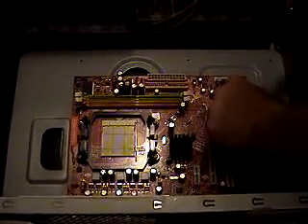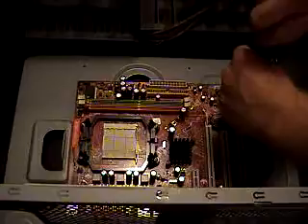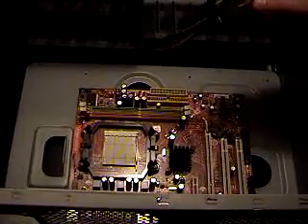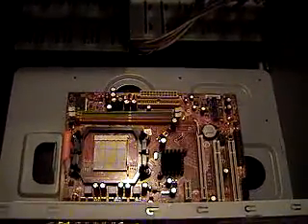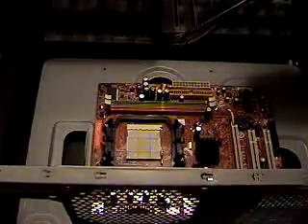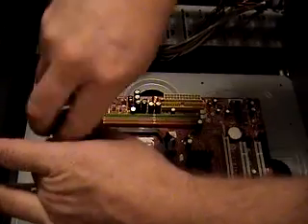You want to kind of slide it over a little bit and get it centered on the next hole, on the next stud, which is in the case. Make sure you have those studs real tight, because if you don't, it might stick on you in the event that you need to take it out in the future. This one's kind of off-centered — you have to balance it and tilt it forward a little bit to get it centered up right where it needs to be. Screw it down — got three more of these to go, and then the motherboard will be in place.